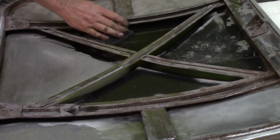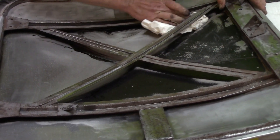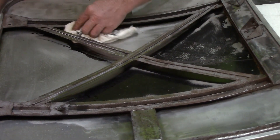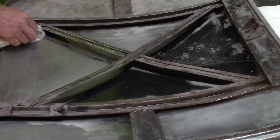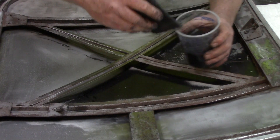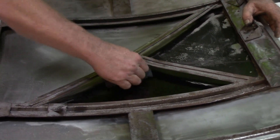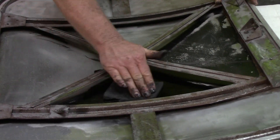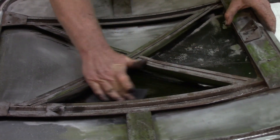These will be pretty nice, I think — hey, just my opinion. We'll wipe this down with wax and grease remover, or maybe even some urethane reducer, just to kill that old lacquer thinner residue. We don't want it on there — it'll make our paint do some crazy things. Now here, I've got holes for the emblems that go on the other side — they're primered over. I've got to work around those. Probably don't want to run lacquer thinner there — I don't want it to creep through underneath my primer and cause a problem later.